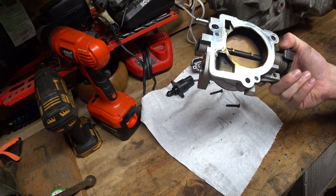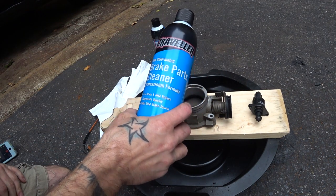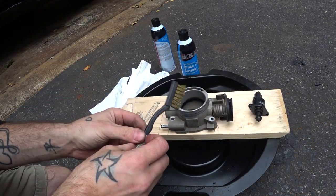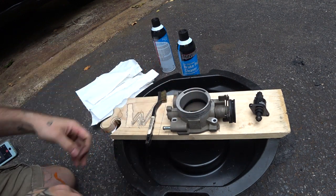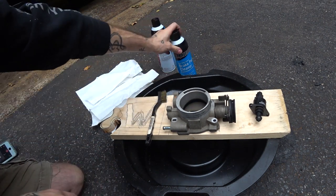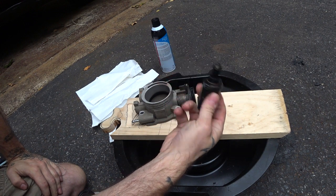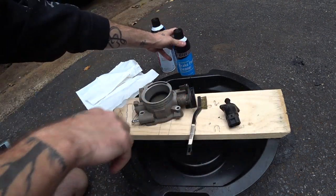We're gonna get some brake cleaner and go into a well-ventilated area. To clean this up you'll need some kind of cleaner — carbon cleaner, choke cleaner, brake parts cleaner, whatever's cheap. Get yourself a brass brush, not a steel brush. A brass brush will help you break up the carbon without scoring the parts themselves. Also grab a whole pile of shop rags and safety glasses; some people like gloves too — this stuff is pretty nasty on your hands. We're gonna intermittently spray it down, scrub it up, and wipe it down until the throttle body butterfly valve and idle air controller are totally clean. Be careful of rubber O-rings — brake parts cleaner destroys rubber.